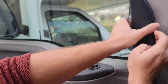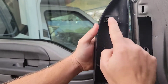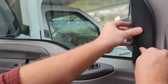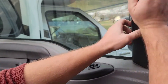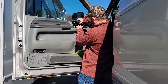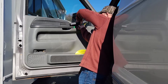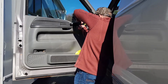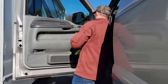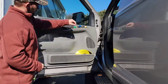This little panel right above the door panel towards the mirror just pulls straight out — it has those clip-type clips and you can put them right back in by pushing them straight back in. Underneath the master panel there are four different connections and they are tight, so you have to wiggle them quite a bit to get them out. Luckily they just have regular squeeze tabs instead of something requiring a tool or screwdriver.